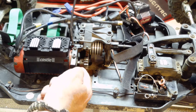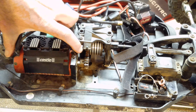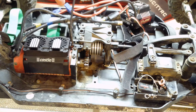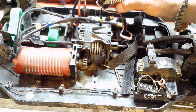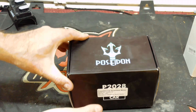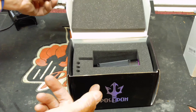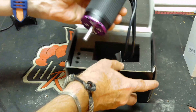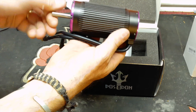I'm going to talk you through exactly what problems I've been having with the motor, which is just a horror story — but bear in mind the motor still works absolutely fine. The problem is a simple innocuous one that appears to have happened from the car under heavy landings. The grub screw on the pinion is fully tightened, but the pinion moves around on the shaft. The shaft has got heavily scored from those big air landings, with a groove cut all the way around it.